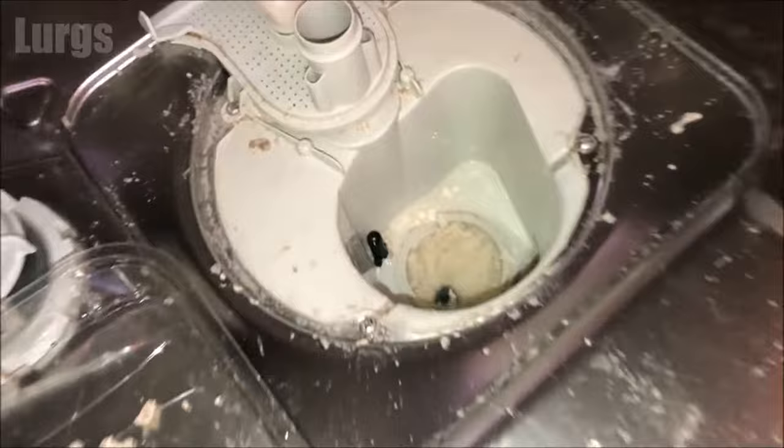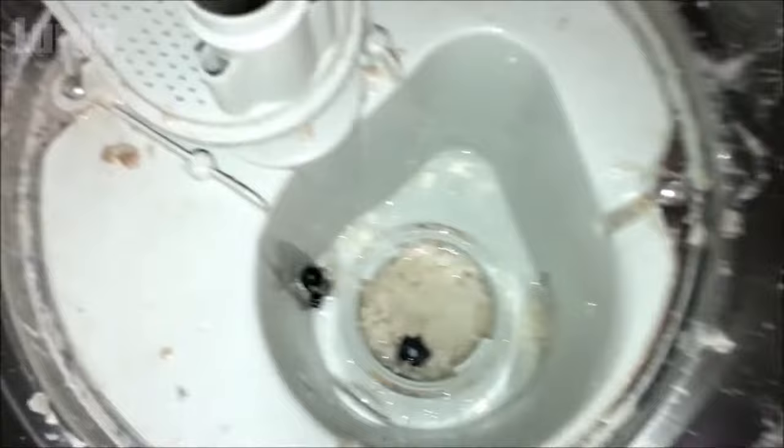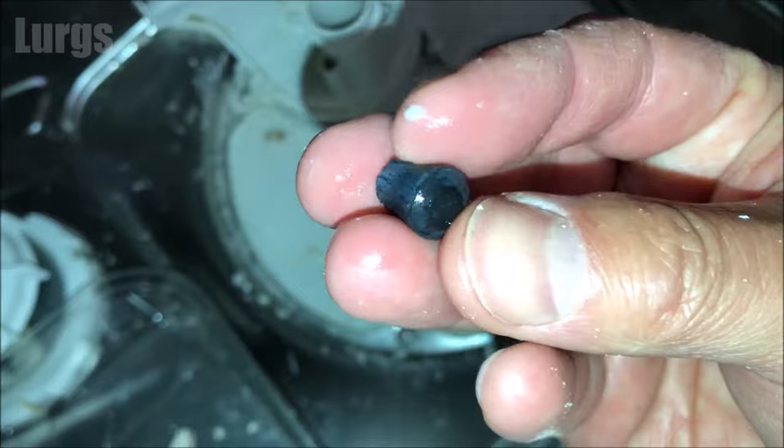You can see there's lots of dirt down here and it looks like there's a bit of plastic in there as well — that's why this dishwasher has not been draining properly, which affects cleaning and can cause flooding in your kitchen. I'm just going to pick this out — it's one of those rubber feet that's come off a plate stand or something like that, so that's not going to do the dishwasher any good at all, and it could easily block the impeller.